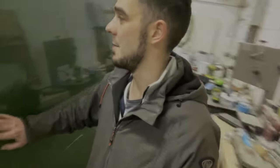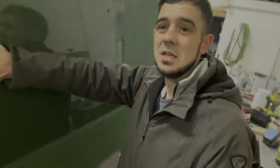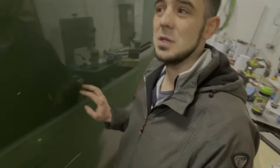So, if you haven't got access to equipment to spray, then just by rubbing your van down, getting it nice, roughed up nice, as you can see, you don't want any of this shine. You need to take all the shine off your paintwork, so it looks dull, like the bottom half of the door there. I say windows going in there, so that's getting cut out anyway. I do need to do a little bit more around the edge where the window's going to bond to, but try and make sure there is no shine on your paintwork whatsoever.